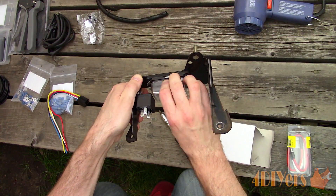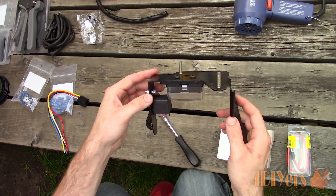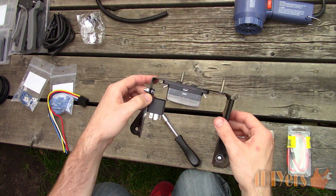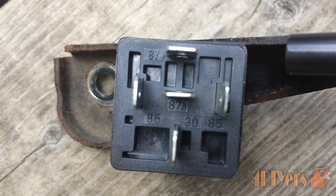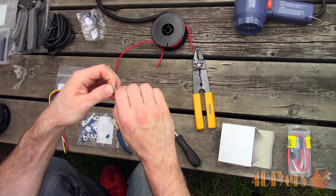Fuses are numbered 1 to 4 and have an LED light. Main power comes in from the bottom post and then divides off to the spade connectors. This is a 5-pin generic relay — I tried to find a 4-pin but none were available locally, so this has two circuits inside: one is normally open and the other is normally closed. We want the circuit that is normally open, so when the electromagnetic coil is activated it will close the contacts, activating the lighting circuit.